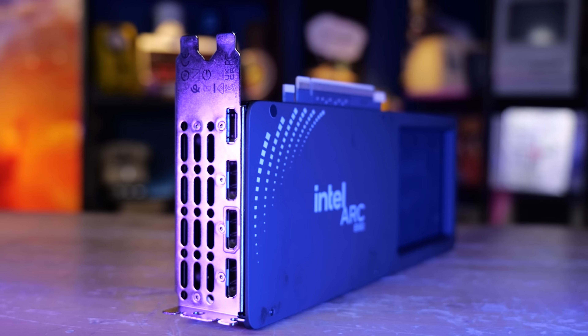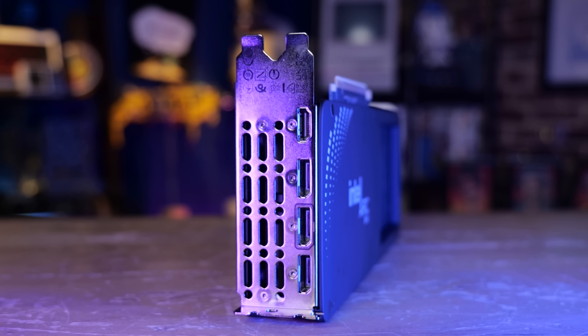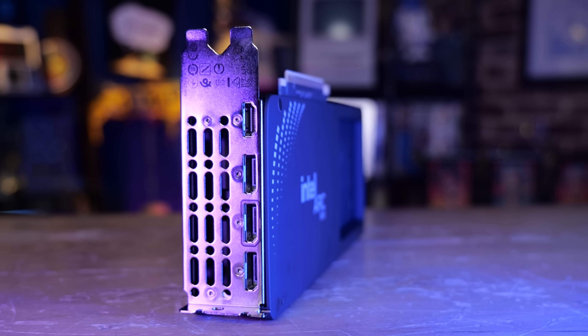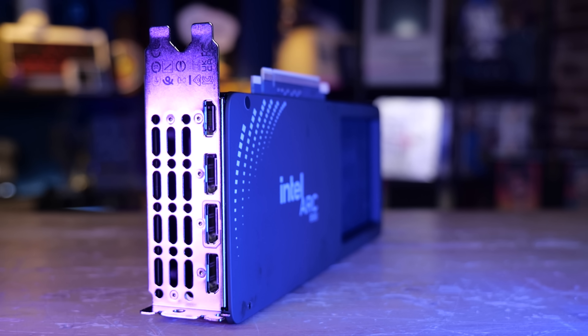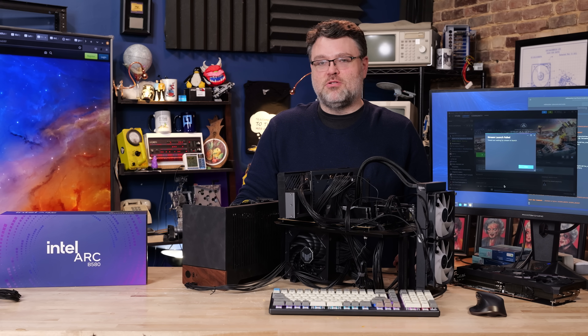Good news, bad news — it's a real HDMI connection, so you can do FreeSync and G-Sync, because FreeSync and G-Sync don't survive hardware converters properly. However, this is a real HDMI port, so you're not going to get full HDMI 2.1 on Linux, at least in my preliminary testing. If I'm wrong about that, I'll pin a comment below, because literally the only thing holding that back is firmware. In terms of DisplayPort interface, it's a perfectly competent DisplayPort 2.1. I've tested DisplayPort compression, 4K, 120Hz refresh on inexpensive and expensive monitors.